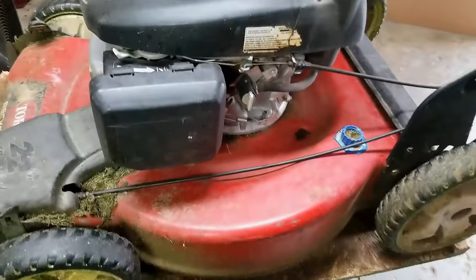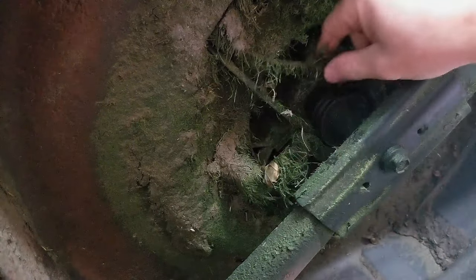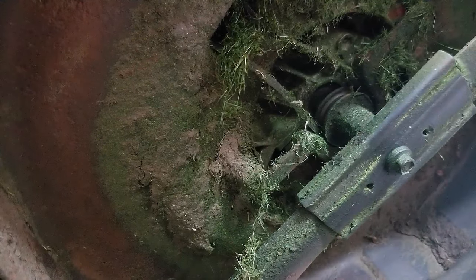The next thing I would do is take a look at the belt on the underside, so I'm going to lift this mower with the carburetor side up and check underneath. I do see that the belt is still on the pulley on the drive shaft, but the belt seems super loose. It's not pulling all the way out so I don't think the belt is broken, but the belt might actually be disconnected from the front side pulley.